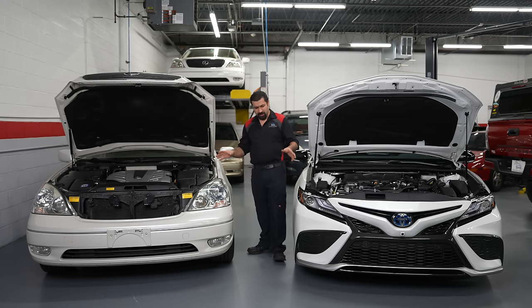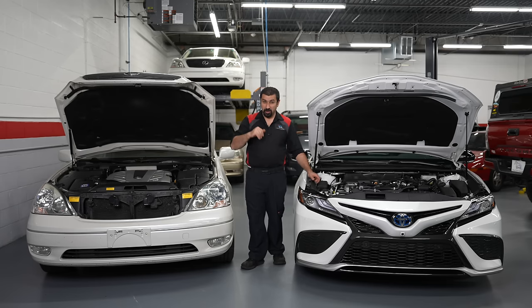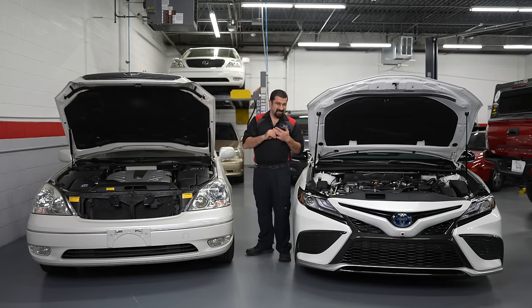The last tip has nothing to do with engine bays, but I'm seeing a large increase in these concerns: please do not clean your touchscreen inside the car with Windex. That will immediately destroy it. It's not Windex specifically — it's the chemical composition. Treat your car's touchscreen like your phone: get a touchscreen-approved cleaner. Every new car now has a big touchscreen and I'm seeing increasing numbers of these coming in with the touch not working after being cleaned with a general-purpose cleaner.